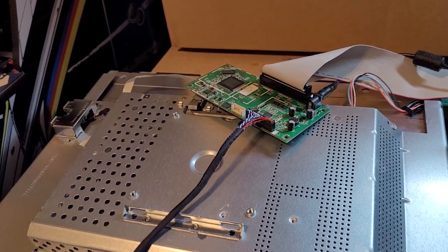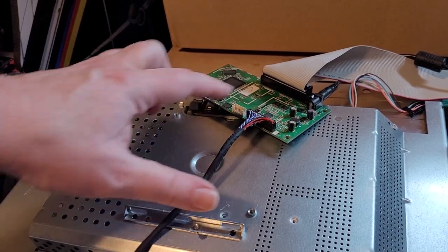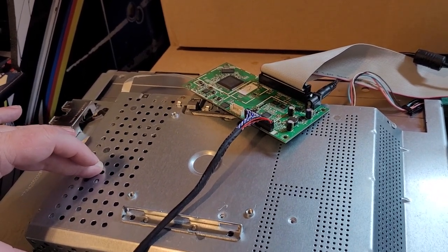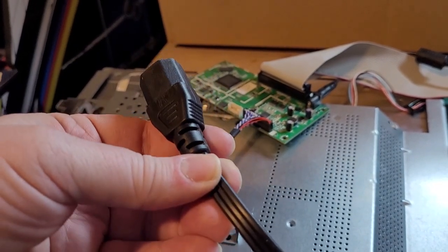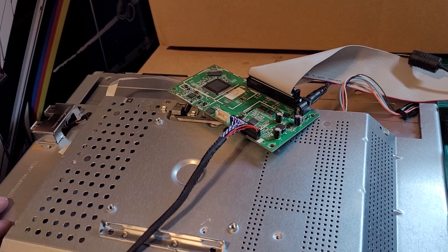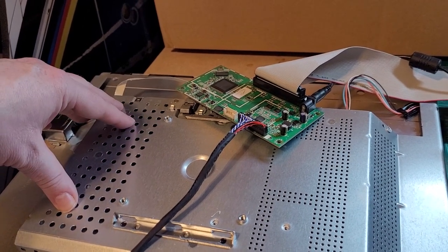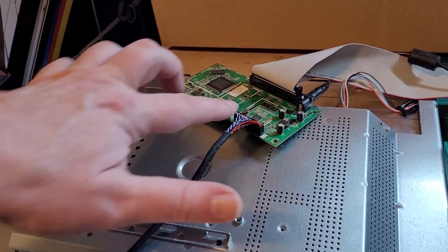If you really want to do it this way, you can use the inverter board that's already in the Dell. In this case we don't unplug the CCFL connectors — they stay in because the internal inverter board will power them. We're still running the display signal from the monitor to the PCB, so the LVDS cable is still plugged in. The difference is we're going to have to apply power to the monitor, so we need the monitor's regular power cable. You're not going to be able to use its USB ports or other inputs since those go to the internal LCD controller board we're not using.